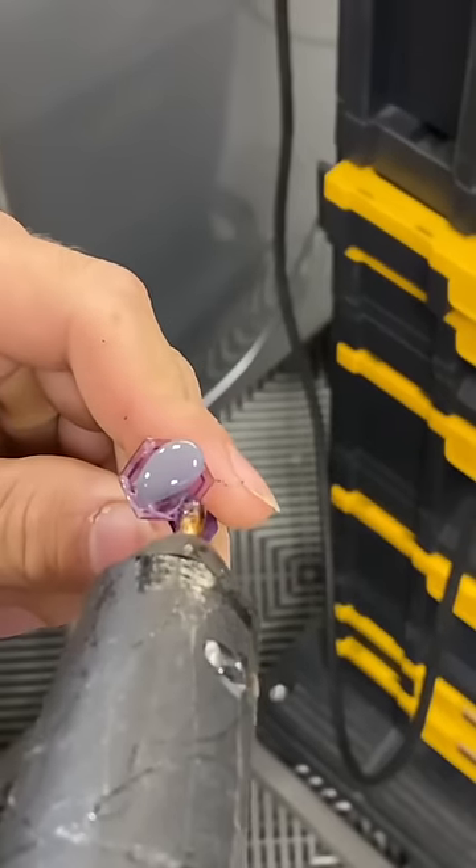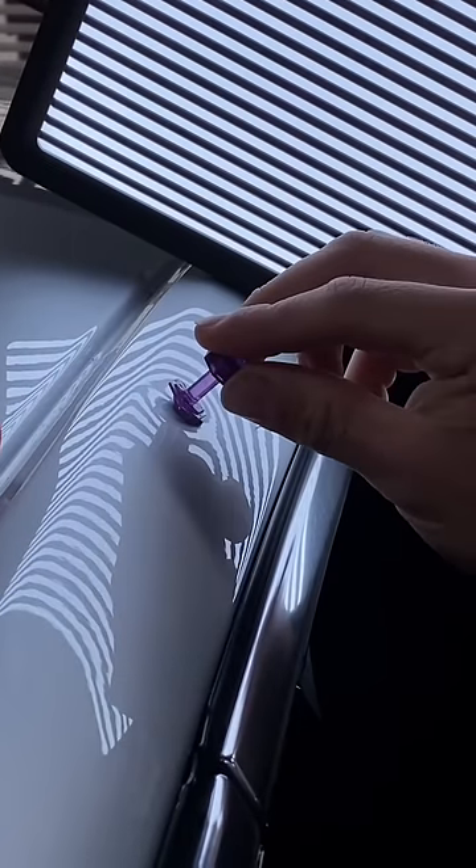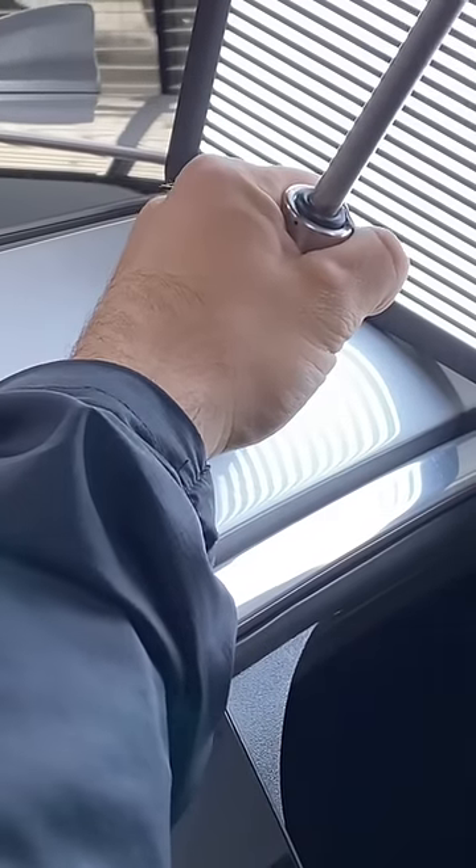Next, it's time for the hot glue and the plastic tabs to make an appearance. These glued tabs are placed firmly in the middle of the dent. Trevor connects the tab to the glued up dent and gives it a good pull.